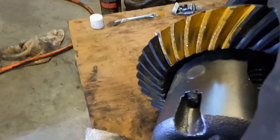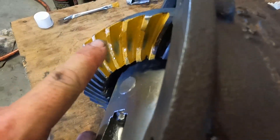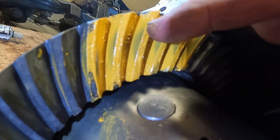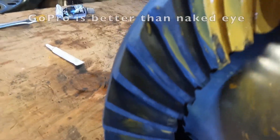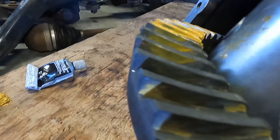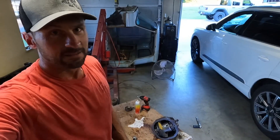This marking compound couldn't be much worse, but I do like the pattern I'm getting — it's centered and goes almost to full depth. Some of these you can tell easier that it's out here on the heel and has a good pattern beginning in the toe. On this side the pattern is centered, goes pretty deep, reaches out to the heel, and is this deep into the toe. So the marking compound I don't think is giving us an accurate reflection of what our tooth pattern really is, but when it does show up I like what I see. That thing is handled, if you will.